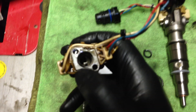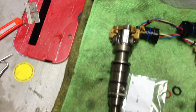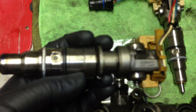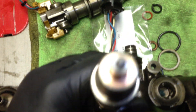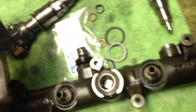Basically, the difference is it's got to seal this whole entire area. What happens is it becomes flush with the metal parts inside and doesn't seal on the o-ring or oil rail properly. Let me just put the oil rail here so I can show you the difference. This is the one with the original o-ring — it just goes in and out; there's basically nothing really holding it up. But when you take the brand new o-ring, you have to use a lot of force to push it in, so no more high-pressure oil leak. This is pretty much something you can do yourself.